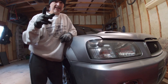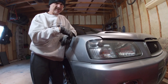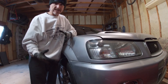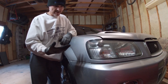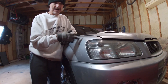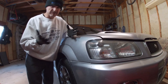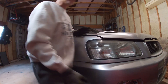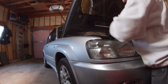We are going to be installing an engine block heater in this Subaru 2-liter turbo 5-speed manual. Here are the first few steps: get the vehicle up in the air — I've got ramps to drive it right on top — to get access underneath. We're going to drain the coolant first. Make sure the engine is cold; you don't want to do this when the engine is hot or you risk burning yourself with boiling hot antifreeze.